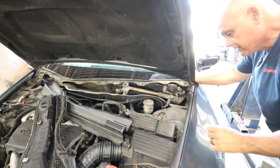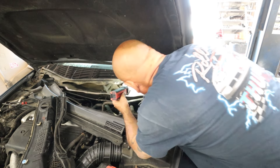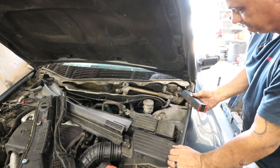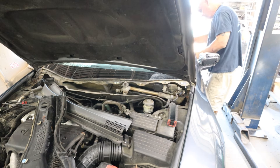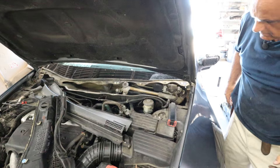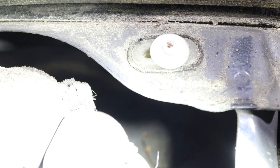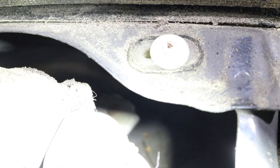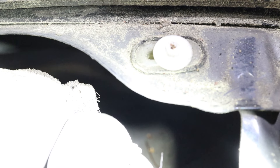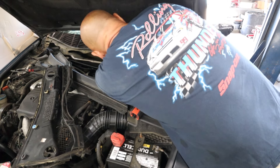It might be the whole transmission that's messed up, let's take a look. So I've got the wiper motor on — if you look right there and see how the motor is working, you see that arm passing through? There should be a bushing on the end of that arm and that's kind of what broke off. I think we might get lucky on this — I think they're just four tens that hold this whole assembly in.